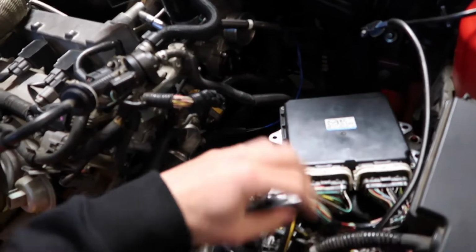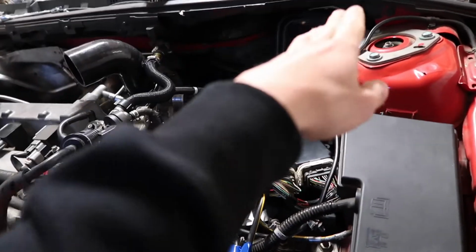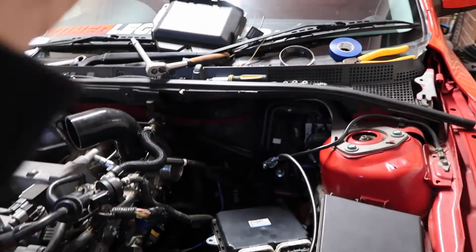And then yeah, I'll just like solder up the battery terminals with an inline fuse in the engine bay side, run through the car. Either I'm gonna go under or through. Through would be better, but I don't know how we're going to do it. I'll talk with Alex, see what we do. And then put another inline fuse in the boot where the battery relocation is going to sit.